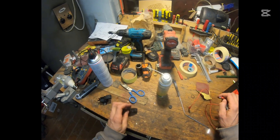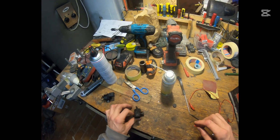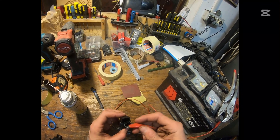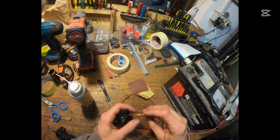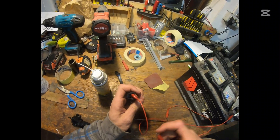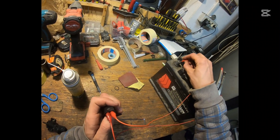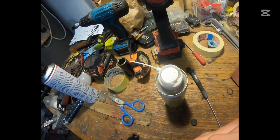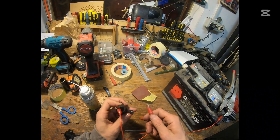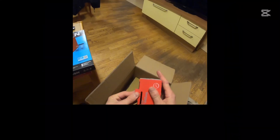If it's not functioning, this is highly the reason for the non-functioning differential lock. I tested both parts. On one, clicking was audible, which means that the function of the valve was actually working, but you could see on the housing that it was all blown up and cracked, meaning it would soon stop working. On the second one there was no sound to be heard.